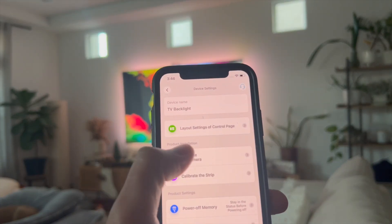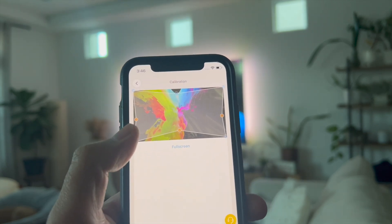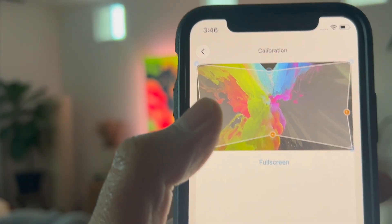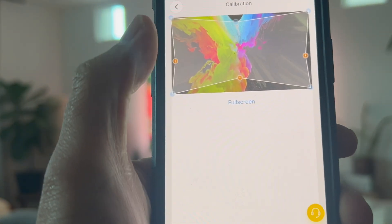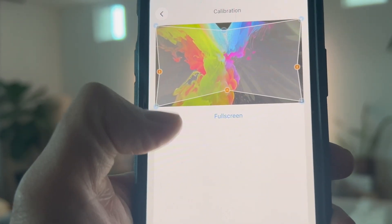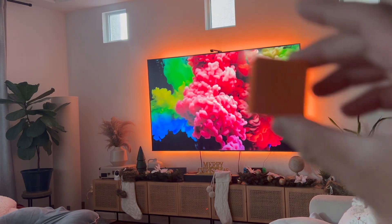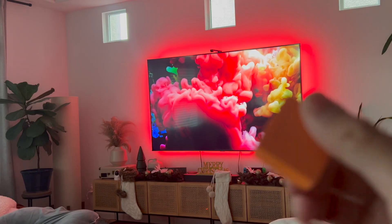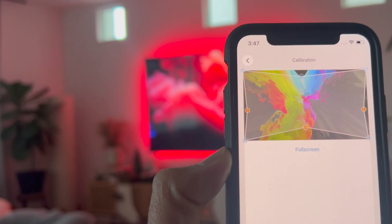What's going to happen here is that it's going to take a screenshot image of what's happening on your screen. You're going to drag and drop or click on restart calibration. It's going to take a still image and then you need to drag and drop these dots to where you see the orange squares — those orange squares that we attached around the TV — to match where they are in the still image of your TV screen.